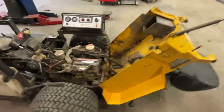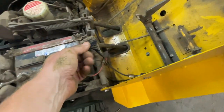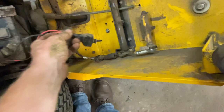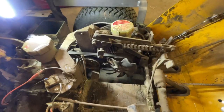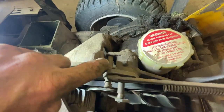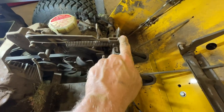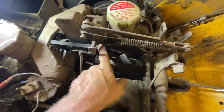Just that one bolt opens us right up — now we've got plenty of room to work on it. I was disconnecting the switch for my headlights, which goes through a hole in the cover and the wires just aren't long enough to reach, so I pulled it out to allow enough room to swing it forward. Next up, we're going to remove the battery. I'll remove this bracket — it's got a nut and bolt down here and one up top, appears to be 7/16ths heads — that takes the whole spring mechanism right off. We'll disconnect the linkages and spring, pull this belt off, and we're wide open.